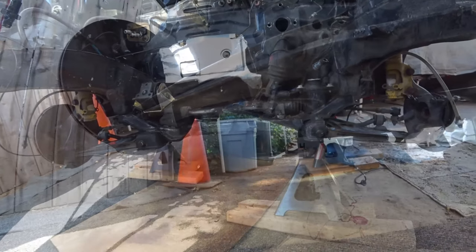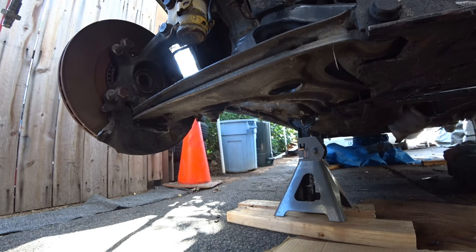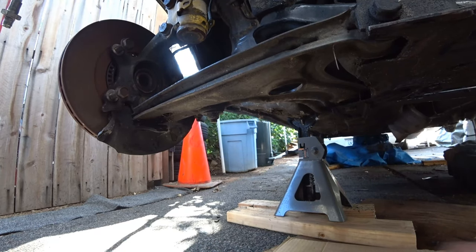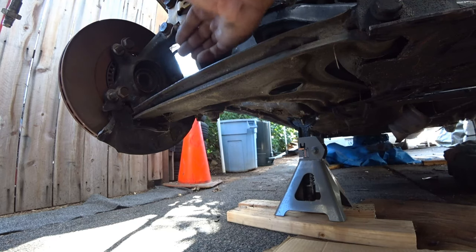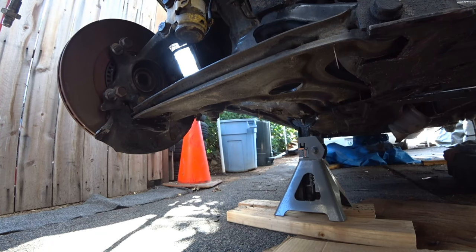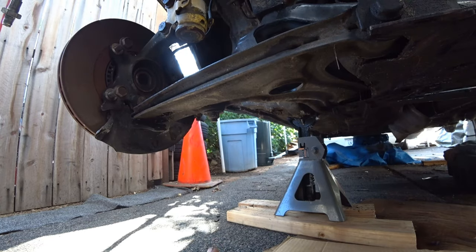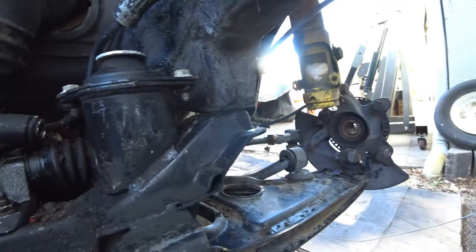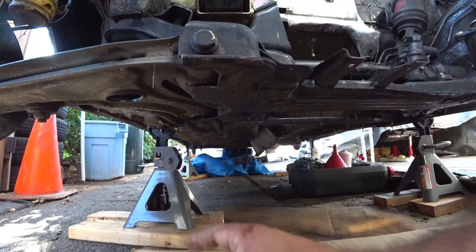This is going to have a really, really nice tight steering system. So let's get to work. I'll give you the sockets that you need: a 19, a 17, and a 13 to do this job to drop the subframe. 13 is for the ball joints, but I don't have any ball joints installed. 19 is for the tie rod ends and also for the subframe bolts. The 17 is for the last one all the way towards the back.